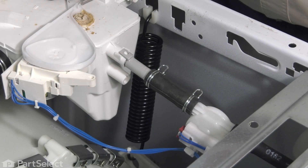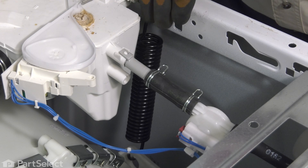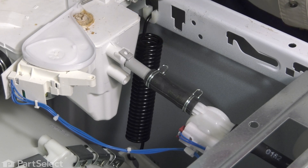We'll set that aside and then we'll go to the front. Now, with the main top removed, we've located the spring that we're going to replace. In this case, this one is still intact. We'll need to remove it from both the outer tub and from this nylon or plastic insert that attaches at the top frame rail of the cabinet.